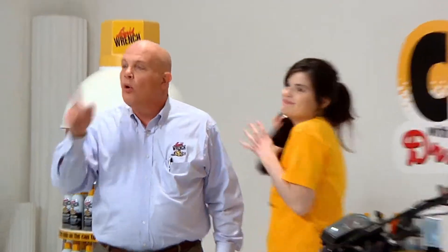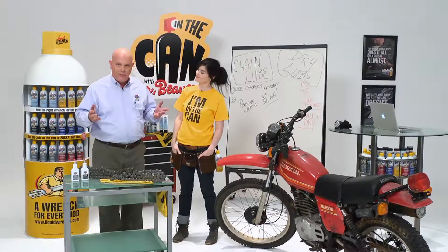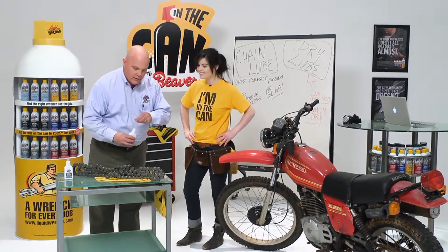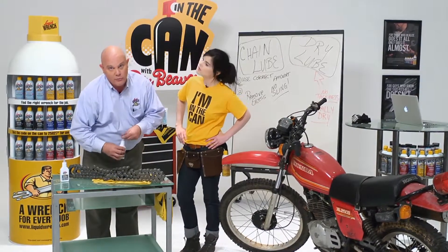My cat, you bring up an interesting point. One of the reasons chain lube is sticky is because we design it that way to stay on the chain. If you're having problems with dirt pick-up and sling over the other parts of the bike, it's likely due to over-application or not waiting long enough for the solvent to evaporate, leaving the sticky lube behind. The best way to avoid that is to apply the product with a dropper bottle into the links of the chain individually, not over the entire body of the chain or on the other parts of the bike.